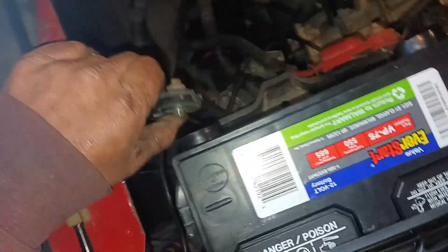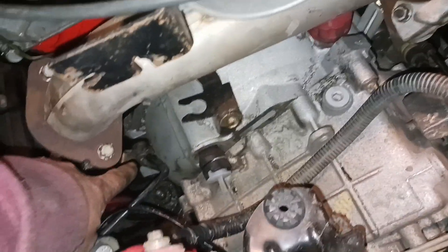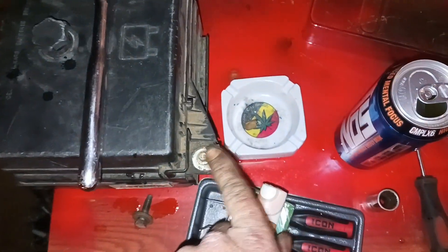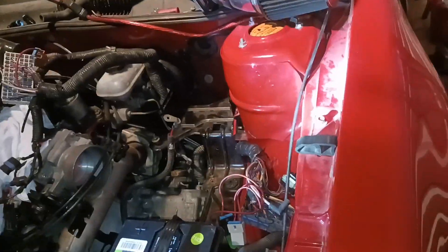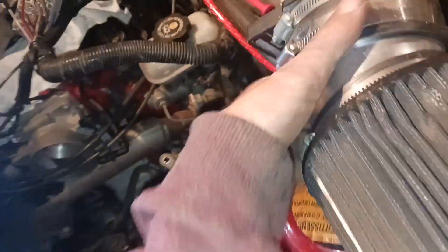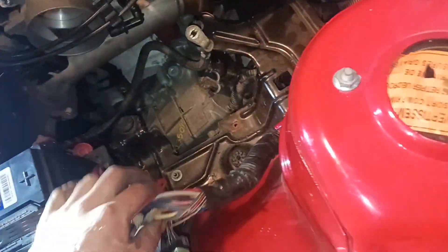I guess that's probably going to be the next step. I've got my ground wire right here — it's grounded, it goes down to the bell housing right there. And then the power is here, this runs up to the fuse box and connects onto this stud here for the fuse box. Everything is coming together. With the battery here, the fuse box goes to about here, so that's going to leave me plenty of room because this harness won't be in my way — it'll be flipped back up in the box.